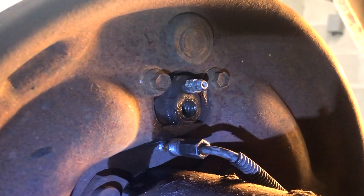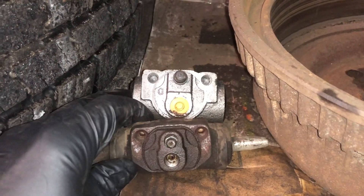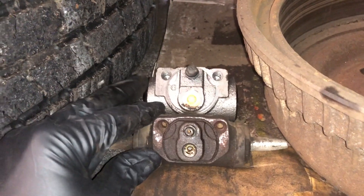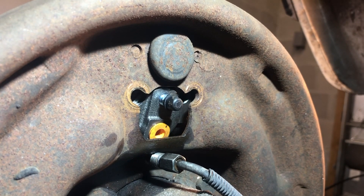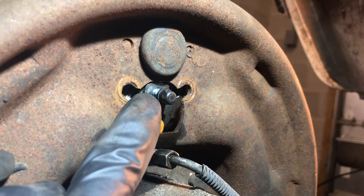This truck is clean, so let's remove the old brakes to access the wheel cylinder. Use a proper line wrench to remove the hard line and two mounting bolts. Here is a side-by-side of our replacement wheel cylinder — you'll want to use a 37337, which is from a one-ton Chevy truck, but noticeably larger, giving better rear stopping power. You can see it will require clearance of the back plate, both at the bottom as well as the bolt mounting holes.